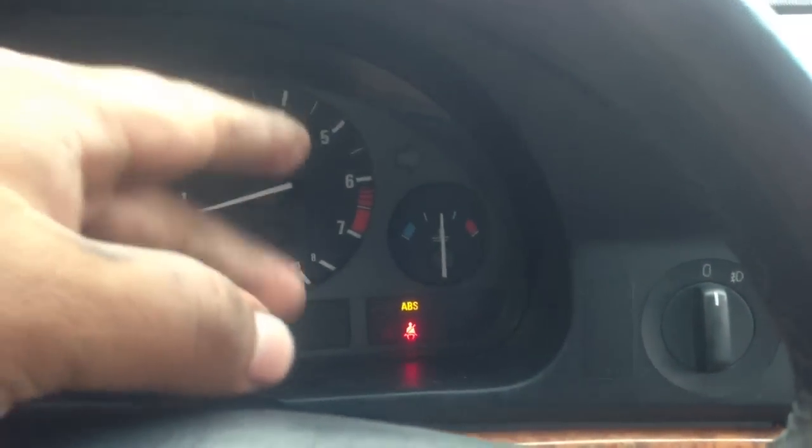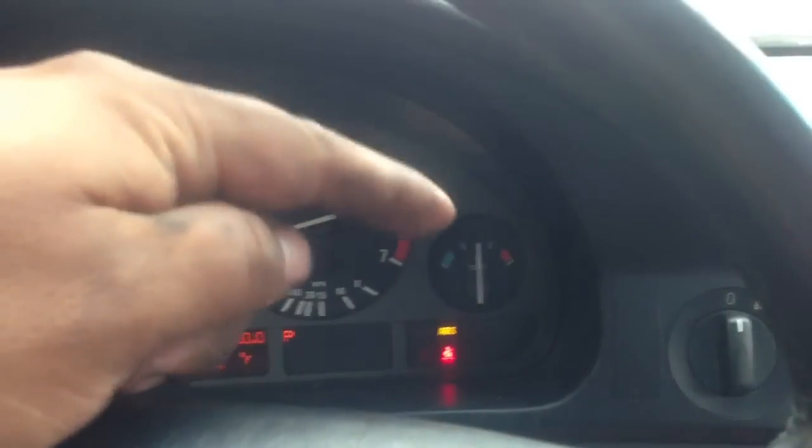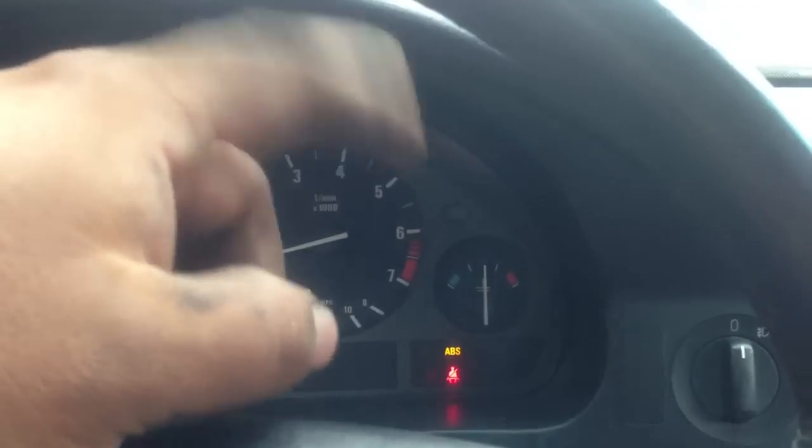So that's a little example. I'm idling right now, so when you're idle and your car overheats, trust me, it's the thermostat that's not opening. I see this happen a lot.